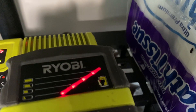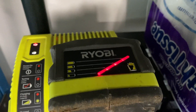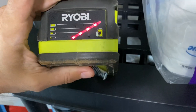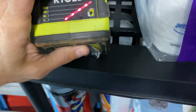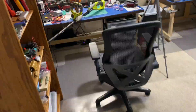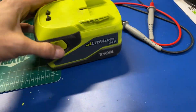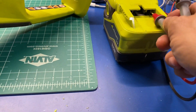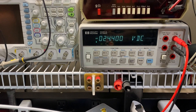If I put it back on the charger for two seconds I'll bet it'll come back to life. It says it's charging — I got full bars. It's a protection circuit. The newer batteries like the Rigid will provide more power overall current. These are older, much older batteries, so it probably triggered an over-current mechanism and killed it out. 18 volt batteries put out more power — that's why they can run the weed whacker. But the other direction? No, cannot use the 24 volt battery on my 18 volt drills. And that's a shame — I was looking forward to blowing up that drill. But protection circuit. Back up to 24 volts.